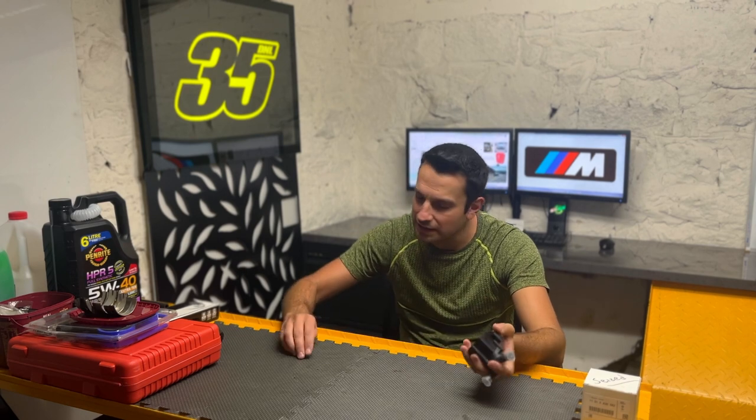This is a very, very tricky one because this pump actually burns out really, really quickly. In my case, as quickly as 30 minutes. I put a brand new pump into a fully rebuilt engine, started the car, cleared all the codes, and ran it for probably 5 or 10 minutes, then another 5 or 10 minutes the next day — a total of about 30 minutes on the engine. Then I scanned the car again and saw the codes for the first time.